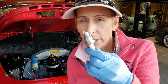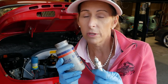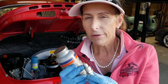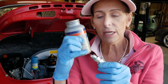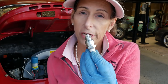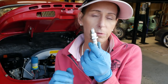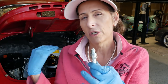We can go ahead and reinstall our new spark plug. I know Porsche put out a notice about using anti-seize, saying it's bad because it messes with the conductivity of the spark plug itself — but these engines specifically, and even the 3.2 Carreras, have a tendency to lock the plugs in if you don't put something on them. So I'm going to use just a tiny little kiss of anti-seize on the spark plug — just enough to keep the threads lubricated over time so they come out easier. Also, make sure the engine is cold when doing spark plugs, because if the head is hot it clamps down and you can gall the threads on the head.